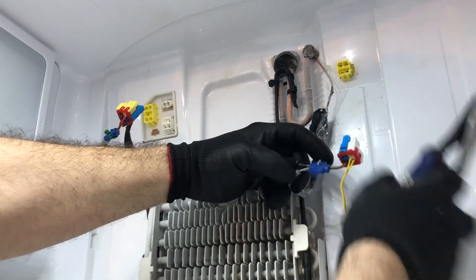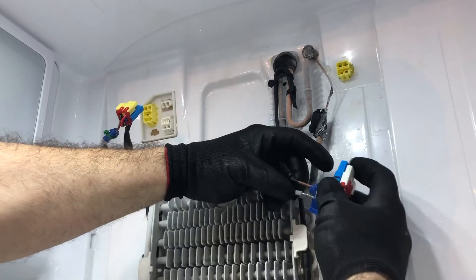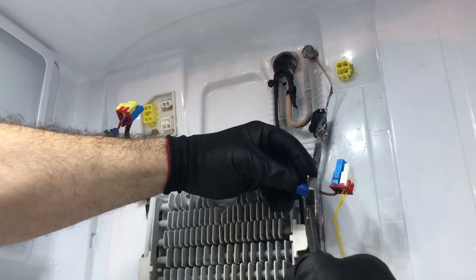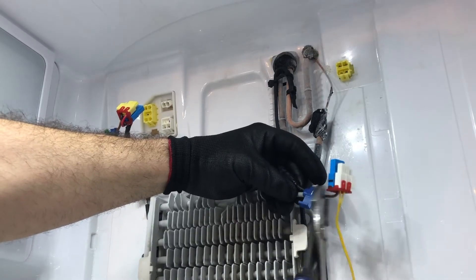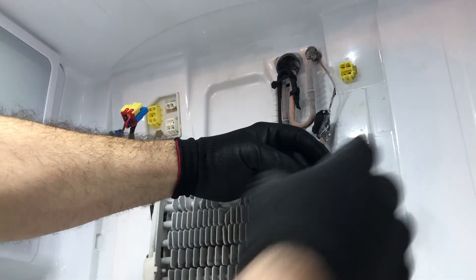Some techs have been having a tough time sourcing the SH502. You can use the SH201 instead — it's the same wattage and the same heat output, but it is a little longer. I just find the SH502 to be more manageable.